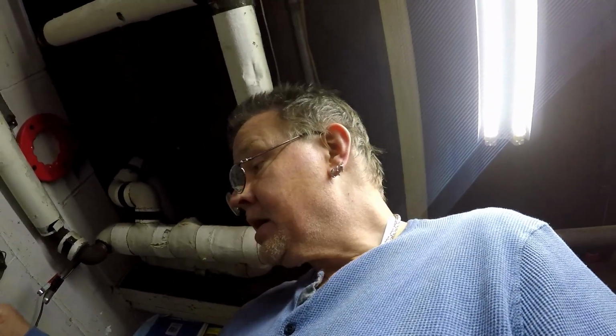GoPro, stop recording. Well, guys, I started getting myself in a pickle. It was staying hazy. I tried the buffing pad by itself and it didn't seem to be getting rid of the haze too well, so I used baking soda and peroxide Colgate toothpaste. That still didn't get it as clear as the polishing compound would have, but it wasn't too bad. Then I went over it with just water and the buffing pad, but definitely get polishing compound if you're gonna do this. The kit had some, but I used it up.